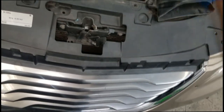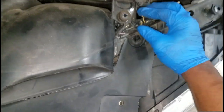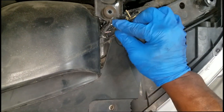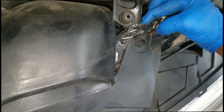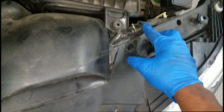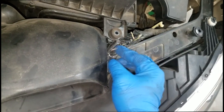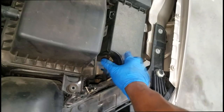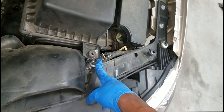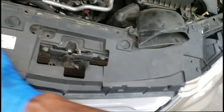In the event of a crash, that sensor will activate and deploy the airbags. Whoa - oh man, there's a problem right here! That's why that code is active. Oh lord, they've got rats - ladies and gentlemen, this looks like the job of squirrels. So that's likely not any physical part damage, just wiring - open circuit. And all those light codes I saw, all those fault codes pertaining to lights - that's exactly what's causing them.